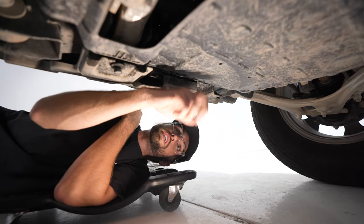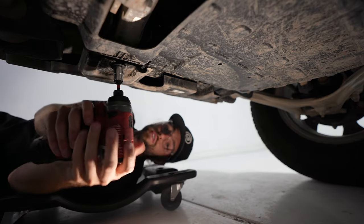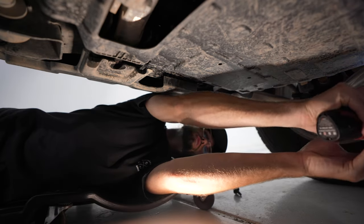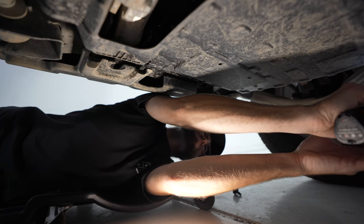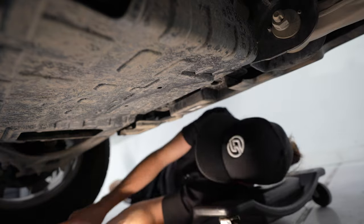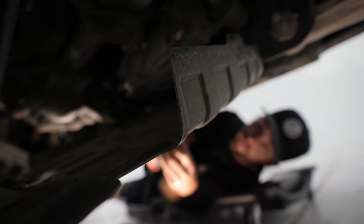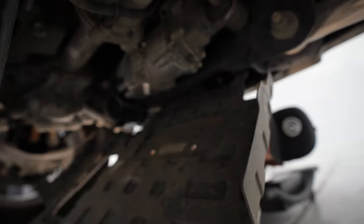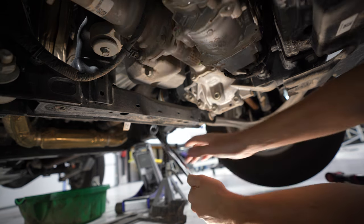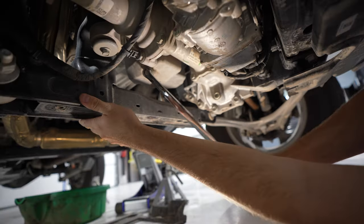Because this is an off-road vehicle, we have a skid plate protecting the oil pan where the drain bolt is, so we've got to get that off. Four — wait, there's five, maybe six bolts — 15 millimeter. This is different than the video I watched. We made it under. We have the oil pan exposed right here, there's our drain bolt, and I can easily fit my 15mm socket and ratchet or wrench on. That came loose pretty easily.